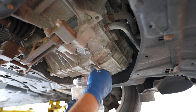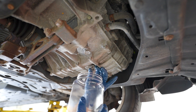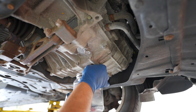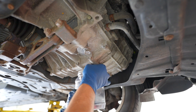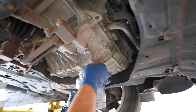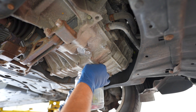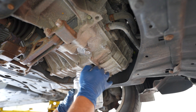Someone's going to say, 'Oh my god, he didn't crack open the filler yet!' — but I'm just getting a miniature amount of fluid out so I'm not in danger of draining the hybrid transaxle and then being unable to open the filler. I'm trying to be careful and not change the level. Getting it out very slowly — a small sample will be enough for this owner.